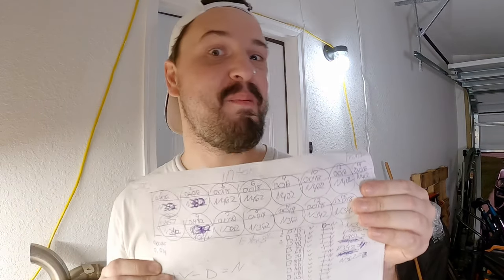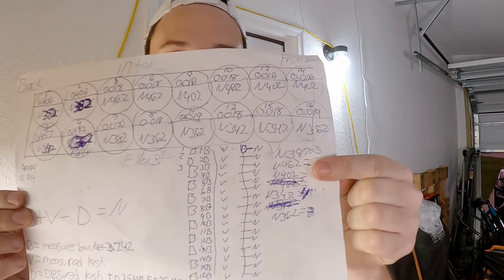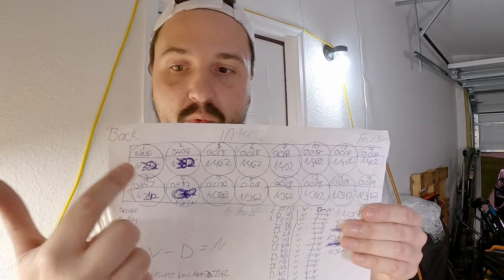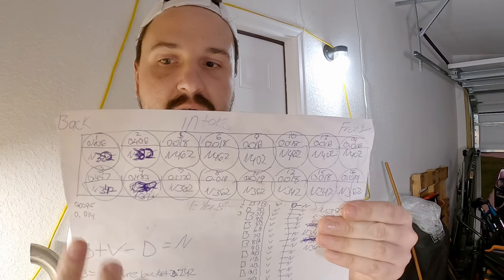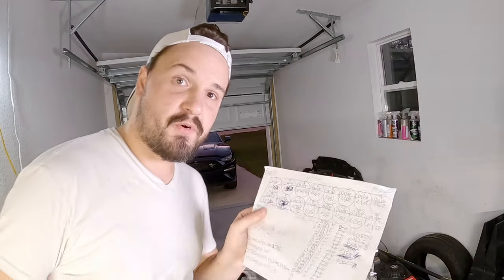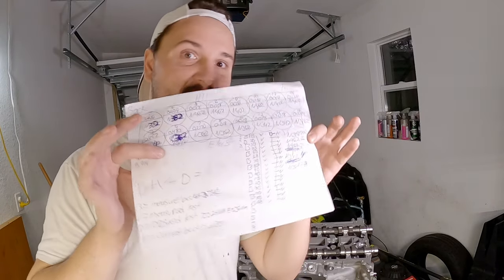So if you're wondering how I've kept track of where all these new sizes need to go on the engine, that's with this paper right here. This is basically my little cheat sheet — this is what I used to measure it. Don't pay too close attention, it looks horrible, basically a bunch of chicken scratch, but it was just for me to read. It tells me all my sizes, my measured size, and where they go. This is the intake side, this is the exhaust side, this is the front, and this is the back. I happen to make a video on how to check the lash for your EcoBoost engine, really any engine that uses this style lifter, so check that out if you're interested.